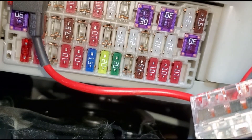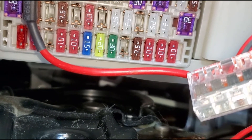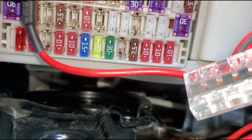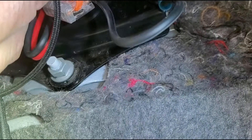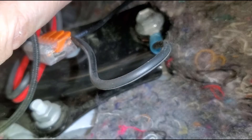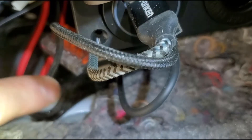All the outer rails are ignition-accessory only, and the inner rail is always-on — so don't tap into that center rail unless you really know what you're doing or you can kill your battery. This black one here is the negatives, and it ties into a post there and then splits that with everything else, acting like a bus bar.